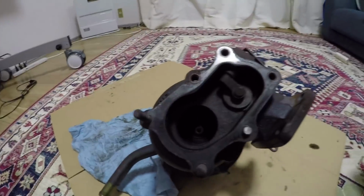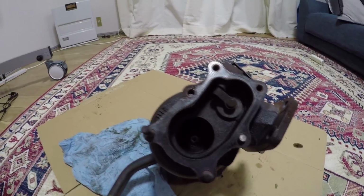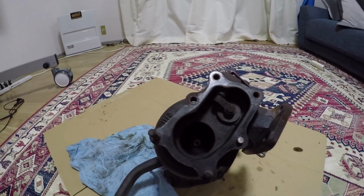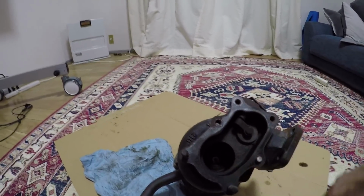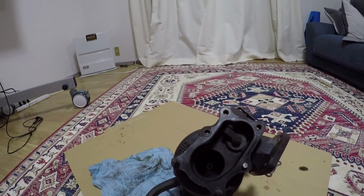So this thing is definitely cooked, and it means that probably tomorrow I'm gonna have to go rear compressor wheel hunting in the downpipe. So I'll take my downpipe off before the cat, and we'll probably find that the compressor wheel is sitting in there somewhere. So that'll be kind of cool. We'll find that tomorrow in tomorrow's video.